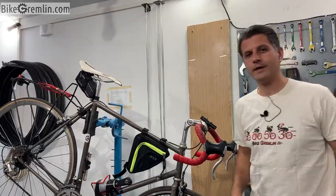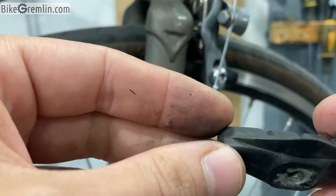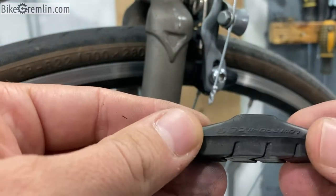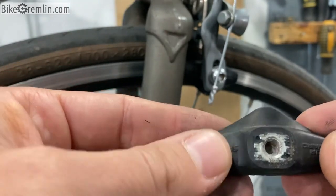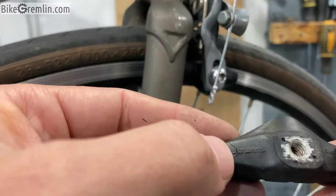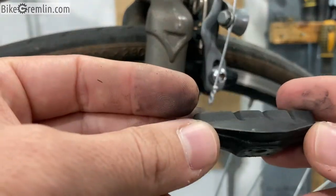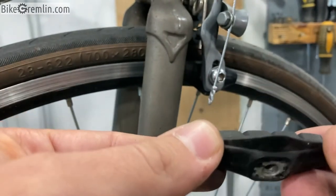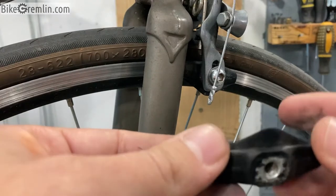You can see these cracks. With brake pads that are all in one piece, it is often the case that the material is more brittle and harder, so they have a bit less brake performance and they can crack — sometimes because they are poor quality, or when they get old — because the whole pad needs to use the same material to fulfill both the function of braking and providing traction and to hold the whole system in place.